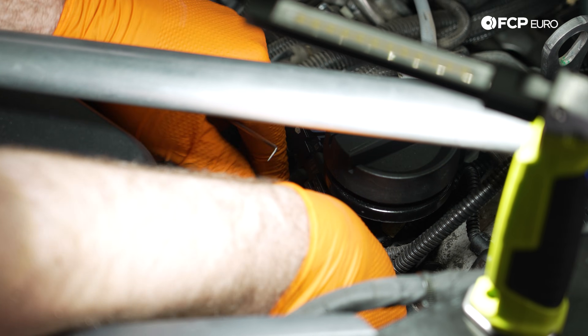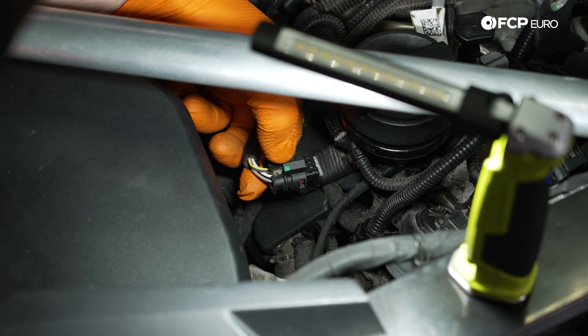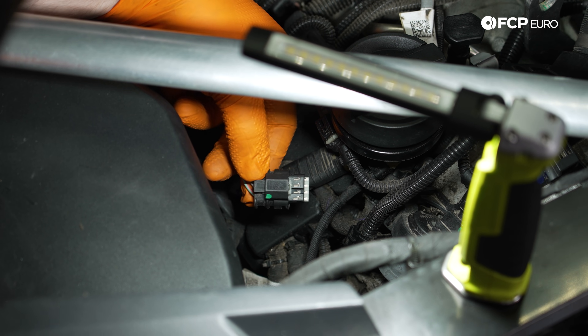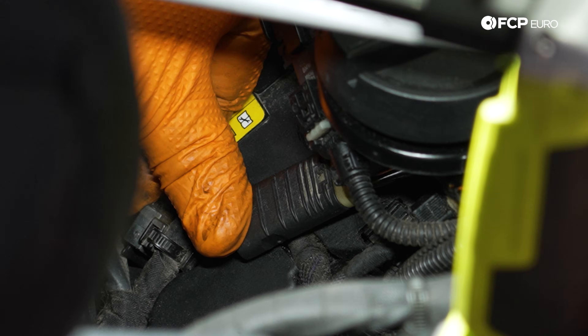As you can see, these electrical connectors are quite fragile — good thing we're replacing this oxygen sensor right here. Those gray locking tabs can slide out really easily, so if you did what I just did, you're going to have to go fishing for that locking tab to reinstall into this connector.